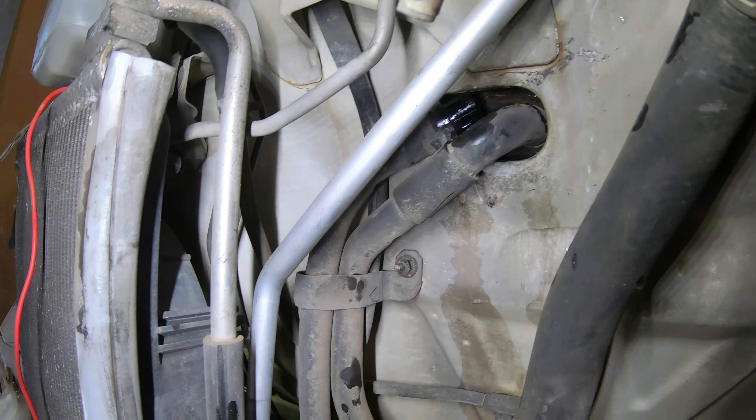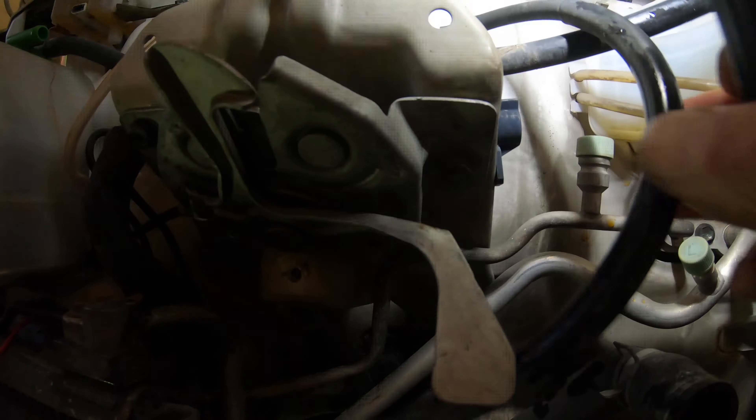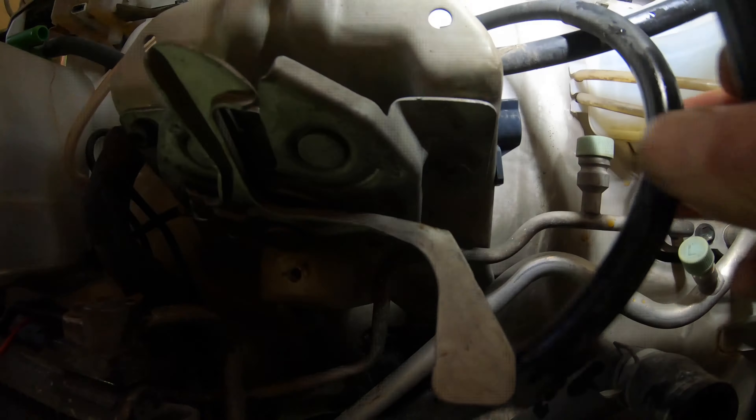This engine is probably fucked — there's no coolant in that at all. Look at it. Did they use red coolant? Red coolant and a shit ton of water. No, that's full of rust. Now we can see the seal that's always leaking — it's all dry rotted and horrible. Look at how this naturally sits, it's just basically touching this aircon line. Quite terrible. Look at the lines of shit coming off there. Probably already had a coolant leak — pre-existing condition.